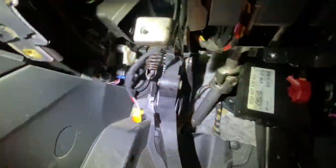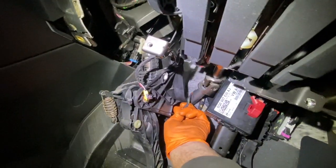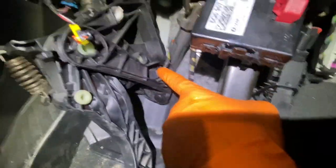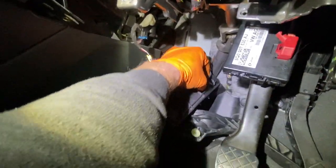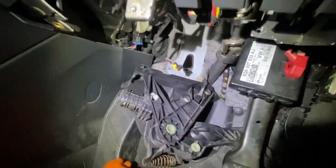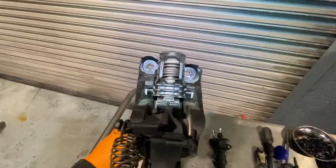The pedal box is not out yet — the nut seems to still be up there but it's just not popping free. I was caught or snagged on plastic grommets. The position sensor that I think caused the no-start condition is sitting down there. I need a small pocket screwdriver — there are four wires on the position sensor. That's all out in hand in a second. I just can't get the little pin with my finger; I need a screwdriver. Okay — pedal box out and in hand.